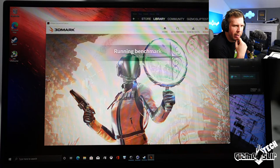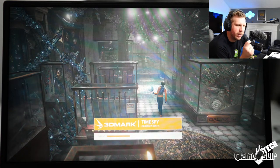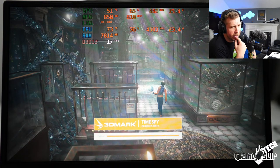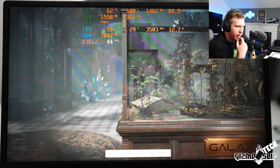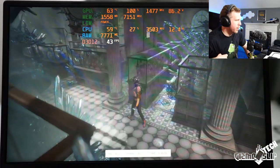Do you recommend the GE76 3080 300 Hz Full HD or the SCAR17 3080 QHD? Between those two, the GE76 will have better raw GPU performance, but with the SCAR17 the display will be better, and you'll have a Ryzen 5000 series CPU, so you'll have better thermals. And the SCAR17 thermals, I think, are just better than the GE76 when you look at the GPU and CPU thermals together, because the GE76 only has two heat pipes to the CPU, so it really is kind of a bad thermal bottleneck for the CPU only, I guess.